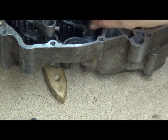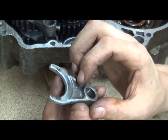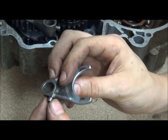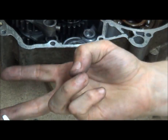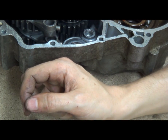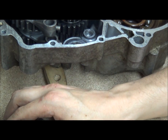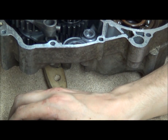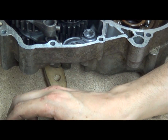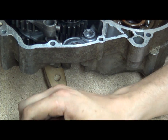The actual forks themselves are literally forks - you do get a bit of wear there, you can see in the light where it's hitting the gear. It's steel, and it's just got this engagement dog here and then the fork that basically just cups the gear and slides it left and right. That's basically it - it is as simple as that. Like I said, there's not much to it; trying to get your head around one of these first time you're looking at it going 'what's going on.' If you don't understand that first and second are usually opposite each other it gets weird. So that's it for selector drums - next we'll move on to clutches, which isn't part of the gearbox, that's a separate thing altogether. See you in a bit.